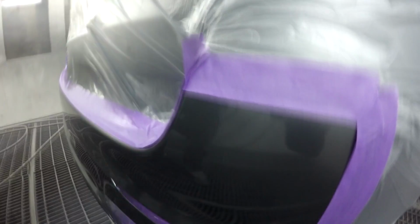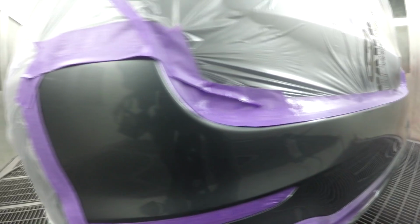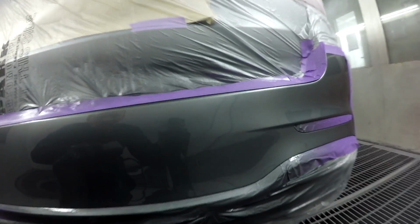But there's nothing wrong with that little spot repair. Nice coat of clear on it. Bang bang, two quick coats, job done. And that should dry really nice and quick because that's the liquid glass extra fast. I reckon I'll give that like a 15-minute bake just to see how well it dries at 15 minutes.